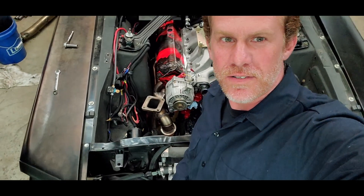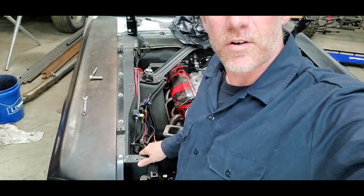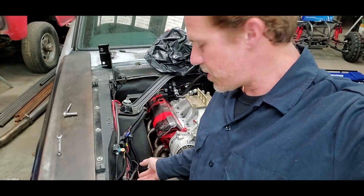What I'm going to do — you can see the scavenger pump right here — I'm going to go ahead and get that out of the car, get the header back out of the car as well. We're going to get the flange or the front cut off that header, leave the two pipes I had mocked up in place because that's where I want them, get the flange cut off the two-into-one collector, and move that forward to basically about where the scavenger pump is located on the apron and go from there. I'm going to try to run the exhaust and get the housing turned so the exhaust will come out the apron.